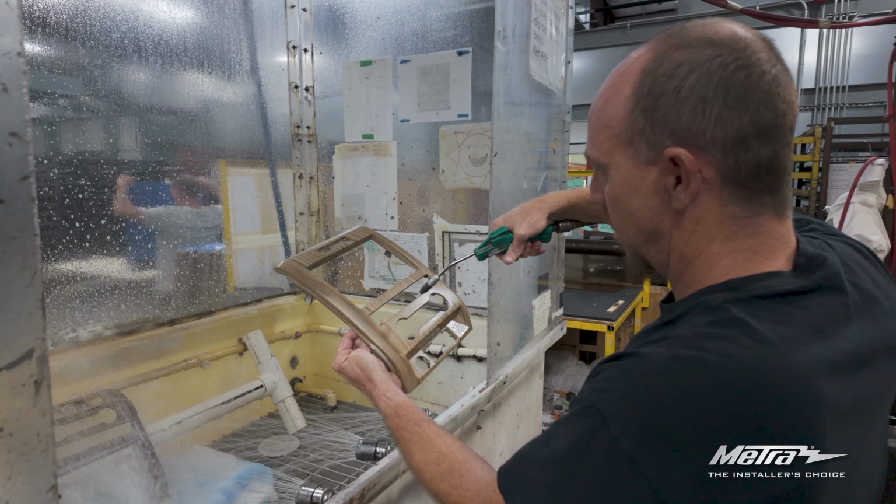After removing the hazard airbag switch assembly, cigarette lighter socket, and climate control from the old panel, clip the hazard airbag switch assembly into the new panel. Also clip the cigarette lighter socket into the panel. Secure the climate control to the new panel using the factory screws.